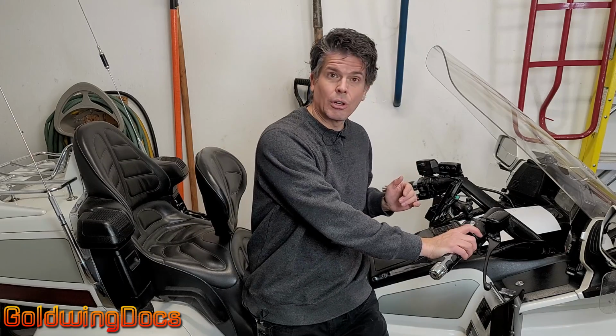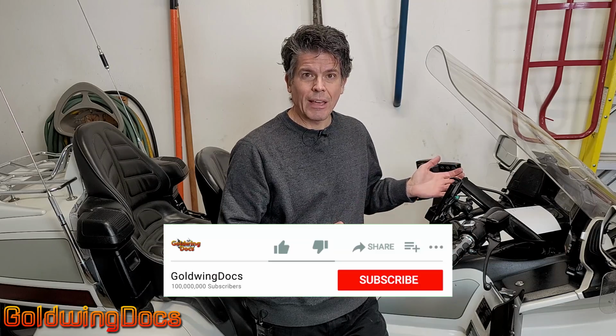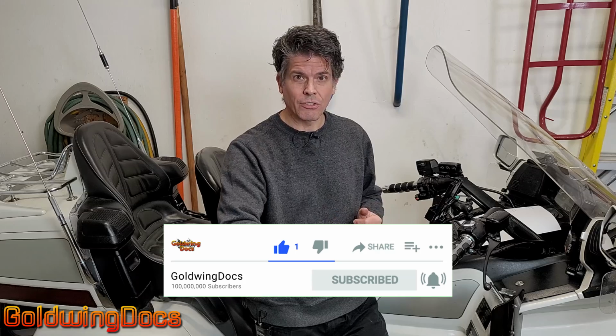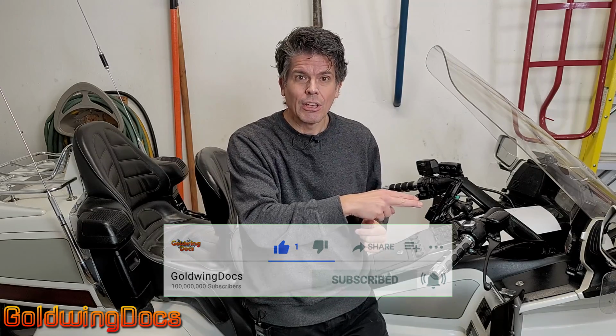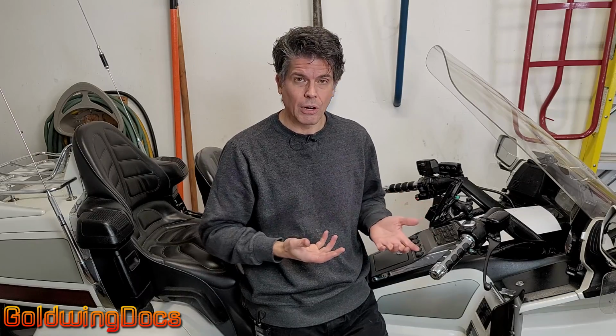That's the reason why you can actually crank the engine on your motorcycle while the engine's running, without doing any damage. You would never do that to a car, because on a car, if you engage the starter while the engine's already running, it shoves that shaft into the flywheel that's already turning, and you damage either the flywheel or the starter itself.